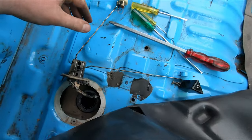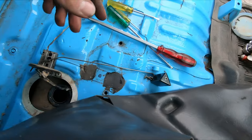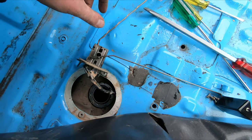I think there's an issue with the fuel sender unit. What I've done is pulled it out — it's pretty easy. I've just pulled the passenger seat out and then taken the little hatch off underneath the floor cover, so I'm sitting on top of the mat, and then I pulled the actual unit out itself.